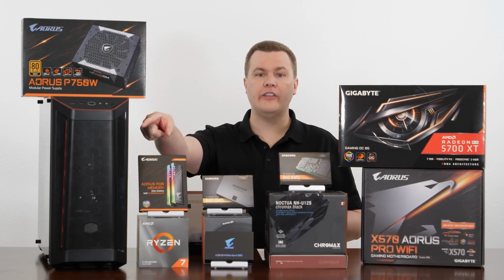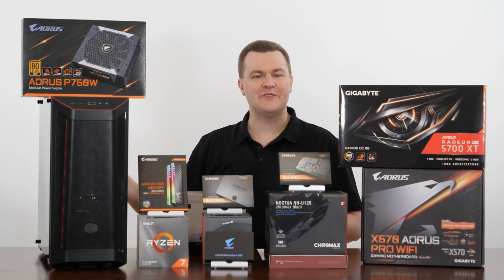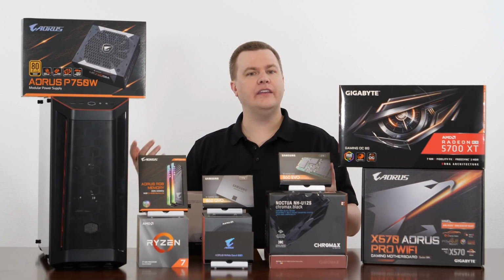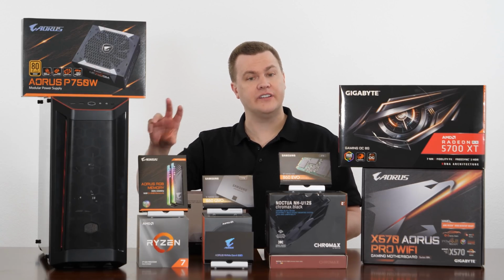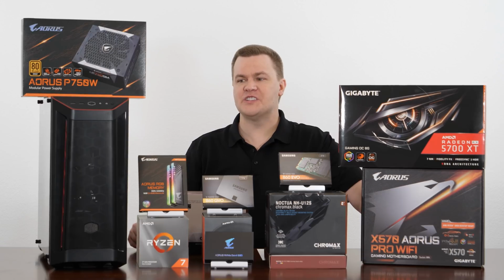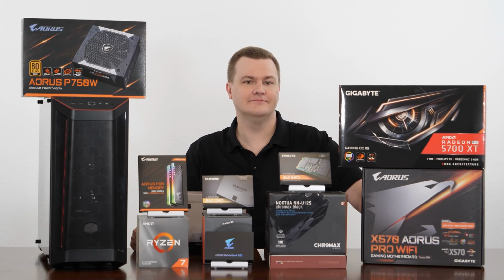You could certainly put 1 in the front, 1 in the back, and nothing on the top and let heat rising do most of the work for you, but your components will run a little bit hotter, and the fans will have to turn a little bit faster to get the air flowing through it, but it's an option if you're trying to save some money. Or just spend $50 more on your case and get a case that comes with more fans to begin with.